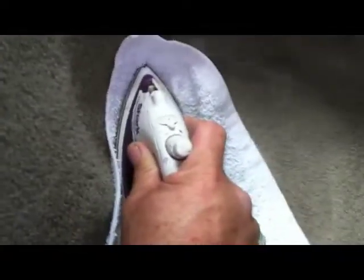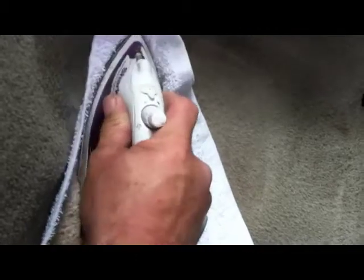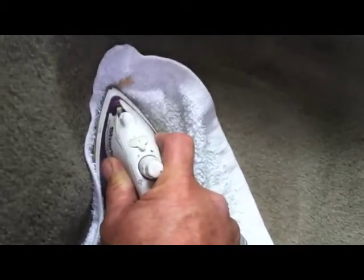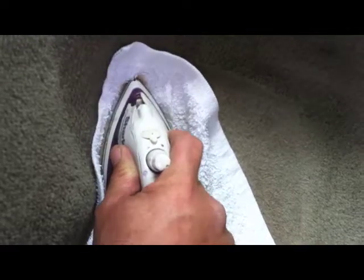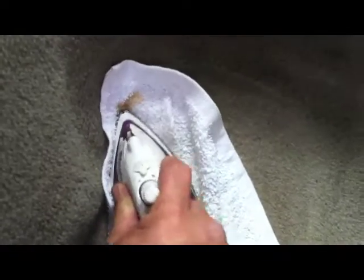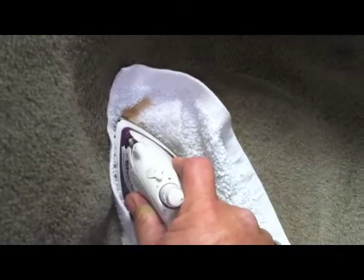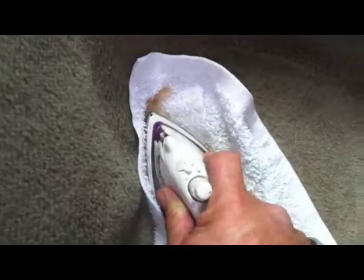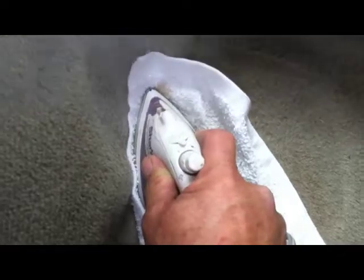and it hits the headliner. If you're not careful with a headliner, you can damage the headliner trying to clean it, especially if they use any type of solvent on it. It'll release the adhesive on the headliner and cause it to sag. We do steam cleaning with headliners to get most of the stains out. Usually if you send me a picture, I can tell you if I can get it out or not, or what the odds are on getting it out.